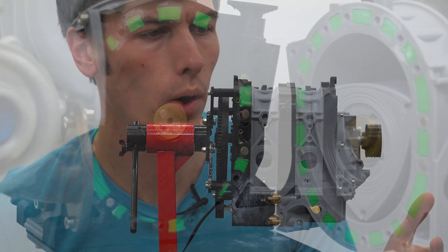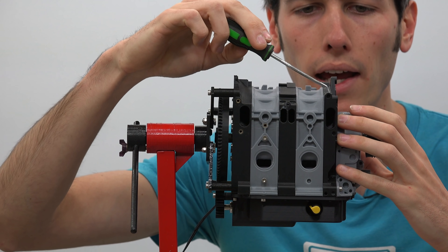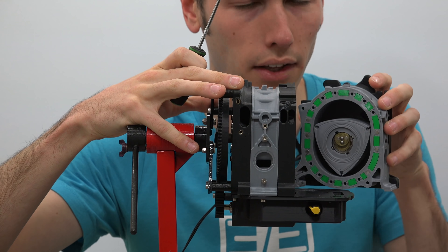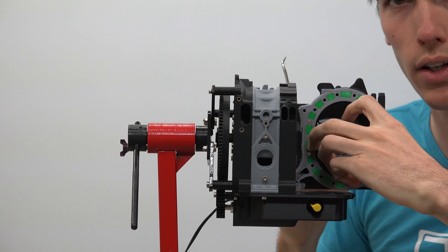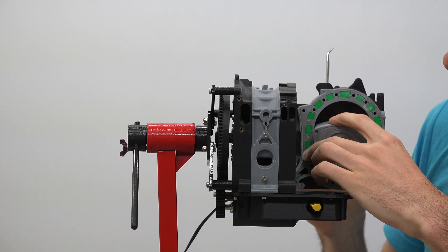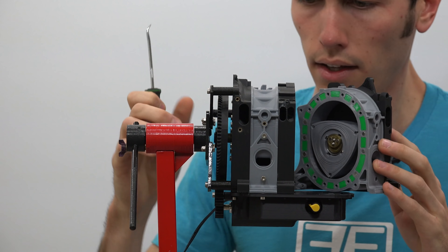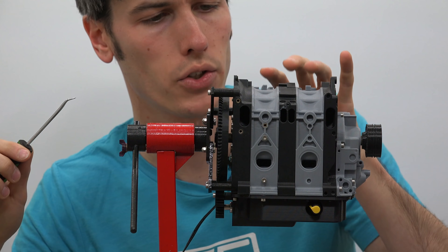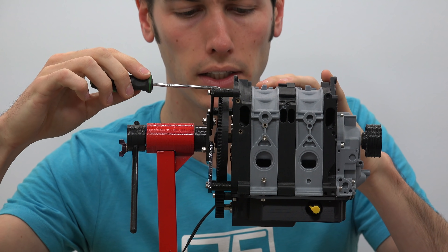Let's start with a walkthrough of the engine and talk about the different components on it. This is the front of the engine here — we have the front plate, and behind that is the first rotor housing. It's called the rotor housing because it houses the rotor. Inside you can see the rotor, which is kind of the equivalent of the piston in a piston cylinder engine. This rotor will be spinning around within that rotor housing producing power, and then we get to our center plate, then our second rotor housing. This is a two-rotor engine, and then we get to our rear plate in the back and finally the flywheel.